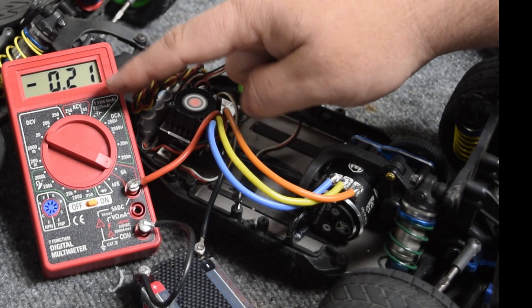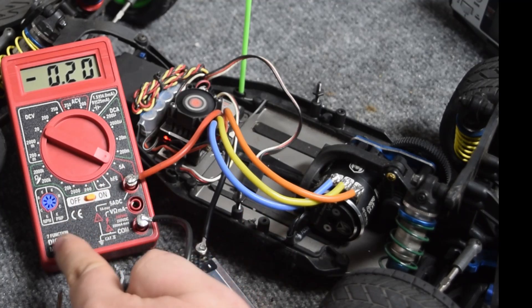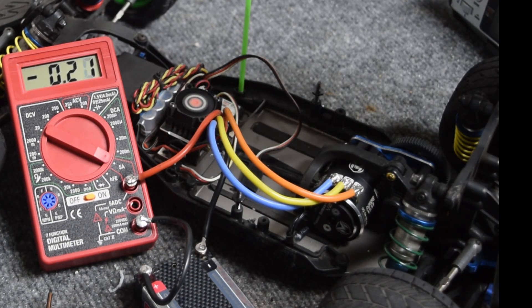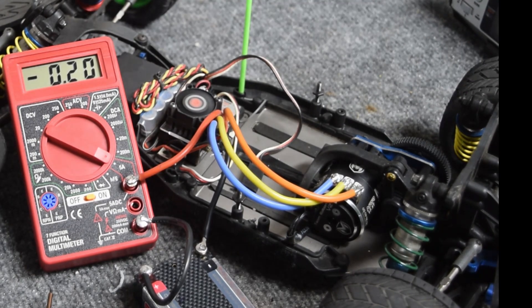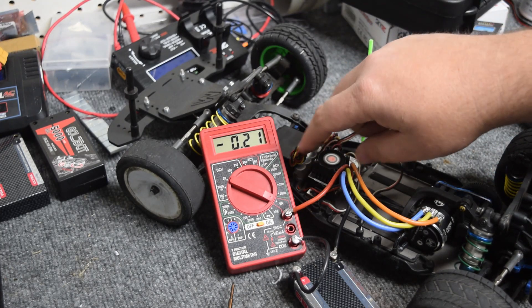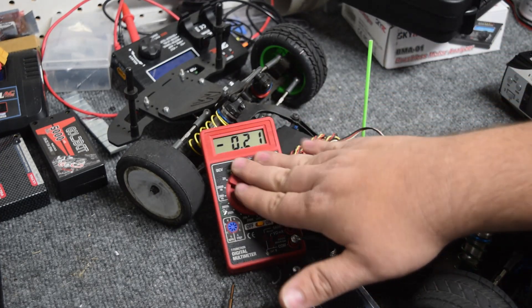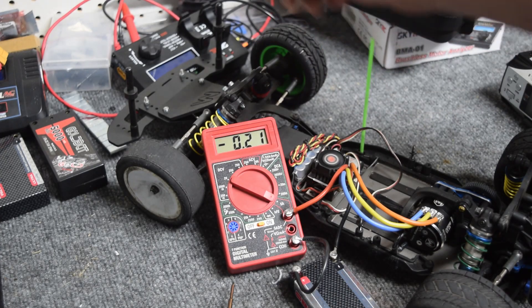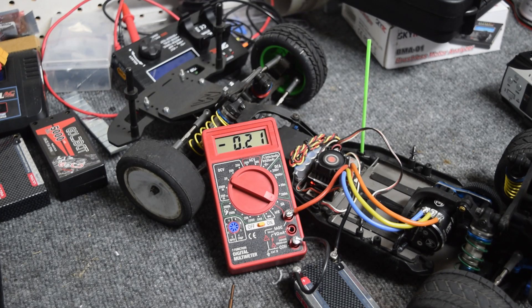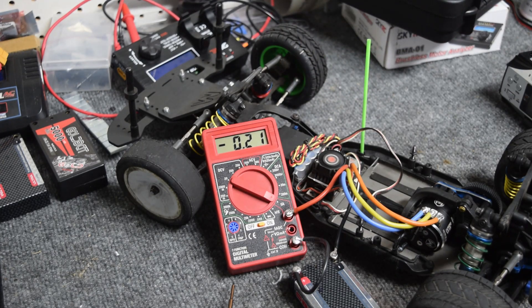You can see that you can use a very economical device — a $1.99 voltmeter from Harbor Freight — to do the same thing that a $100 motor analyzer will do, if you know how to use and read it. This method is actually a little safer because the amp draw is measured through the electronics, not directly through the motor. So setting it to five and a half amps here is safer than five and a half amps on the motor analyzer — notice it read 7.4–7.7 when the analyzer was showing 5.4 amps. That's your difference from going through the electronics with all the power demand included.